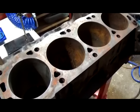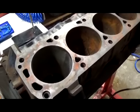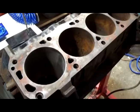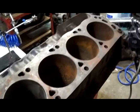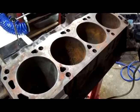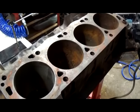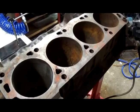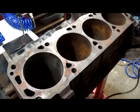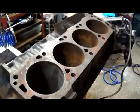In the next installment we'll magnaflux the other deck, check that it's nice and straight — it's going to be machined anyway but we'll still do the check. We'll also check underneath and start getting the mains restored, doing electrolysis on it. We'll get this cleaned up as best we can before taking it to the machine shop to have it professionally cleaned — that's an if. We have other projects to get to: there's a 22RE Toyota block out there that needs to be restored for a customer. It's sitting out there collecting rain and is in rough shape. But anyway, we're done with this hunk of crap and we'll be back with the next installment.